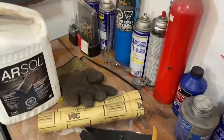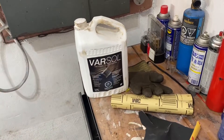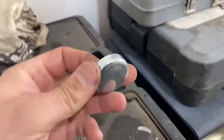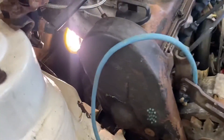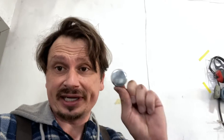Then I'm going to use some 320-grit sandpaper and sand inside that hole so it's nice and clean bare metal. Then I'll grab some varsol and a clean rag and clean in that hole until that whole area is basically spotless, clean, and dry. I might even dry it up with a hair dryer. I'm also going to clean the plug itself. If you don't clean it good, it will never not leak. This should take about 10-15 minutes.